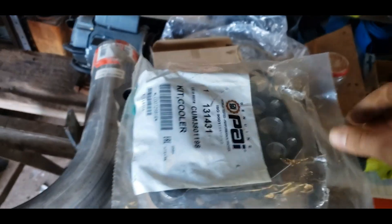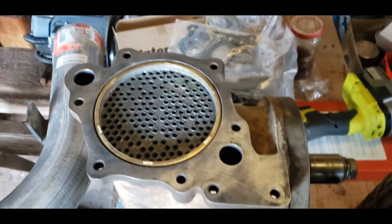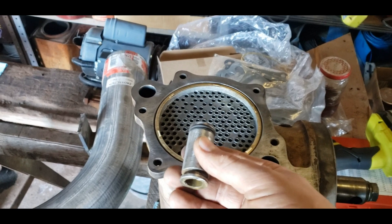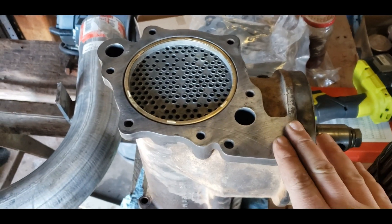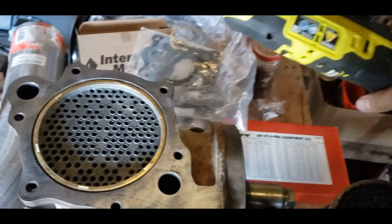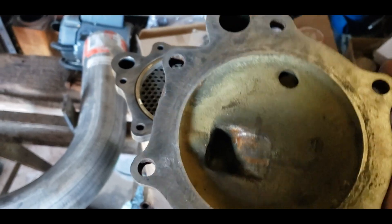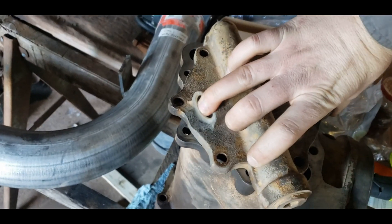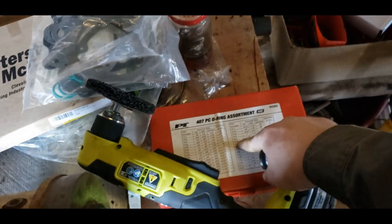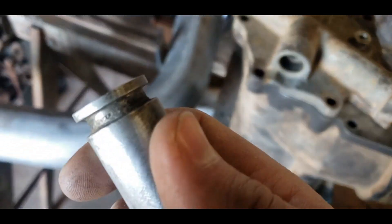They also sent another square gasket in here for the port on the block where the crossover doodad goes from the back plate into the block — I'm going to pull that plate off and reseal it. I cleaned this surface up using a rust remover disc from Tractor Supply, which actually worked really well. You don't want to scratch it up too much but you want it pretty smooth so you don't have to use sealer. This got cleaned up pretty good too.